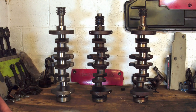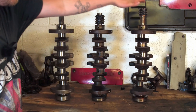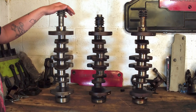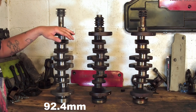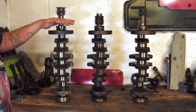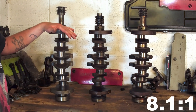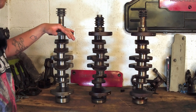Let's get into the weights of these crankshafts, but first the stroke. The M111 975 and the M111 983 EVO both share the same 88.4 millimeter stroke, whereas the diesel OM601 crankshaft has a 92.4 millimeter stroke. With M102 connecting rods at 145mm, this will turn an M111 engine into a 2.4 liter engine with a lot more swept area, giving us a compression ratio of around 8.1 to 1 on our Franken Boost engine.